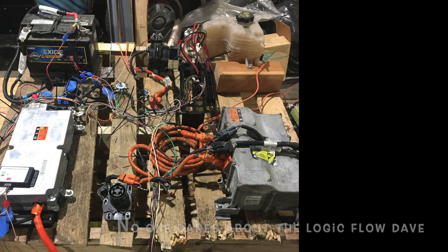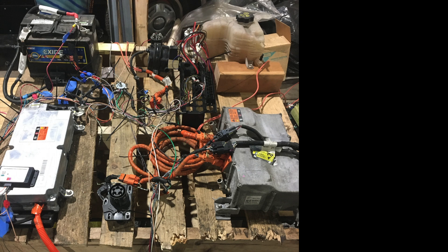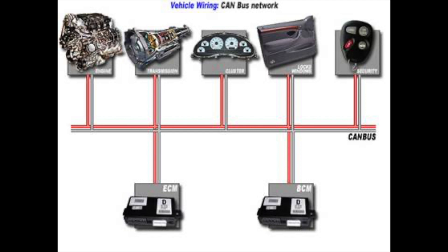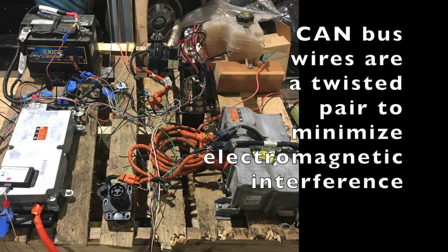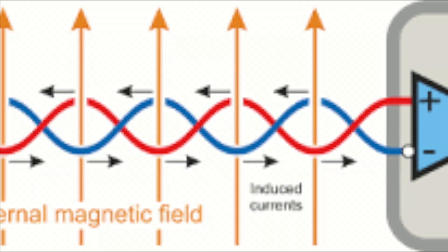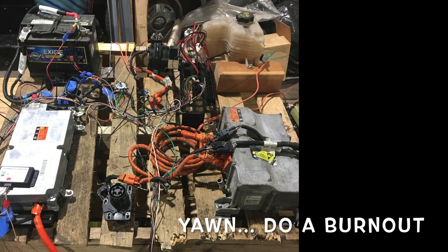All these commands from the EVCC to the charger and also to the DC-to-DC converter are CAN bus enabled. CAN is a common protocol used in pretty much every modern vehicle — it's a communication language that allows bytes of information to be sent and received for feedback to control modules. It reduces the amount of wires while increasing the amount of information you can send back and forth. The CAN bus is the physical wire network connecting these components together — it's a pair of common electrical wires, and oftentimes they're twisted around each other to prevent outside magnetic interference from interrupting the signals.